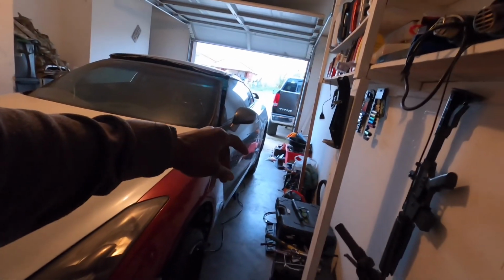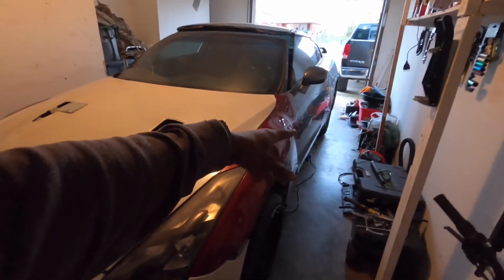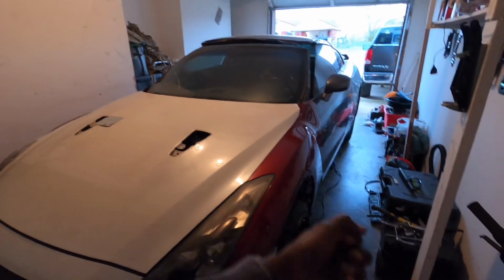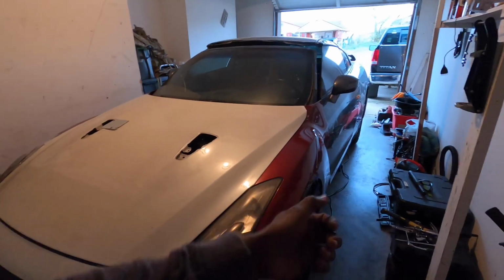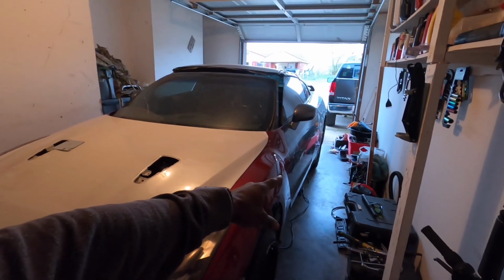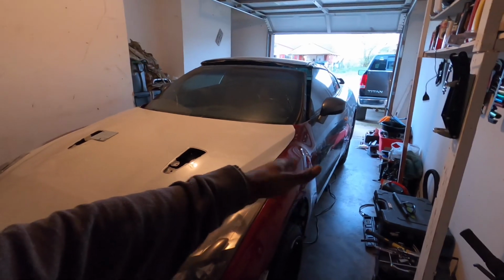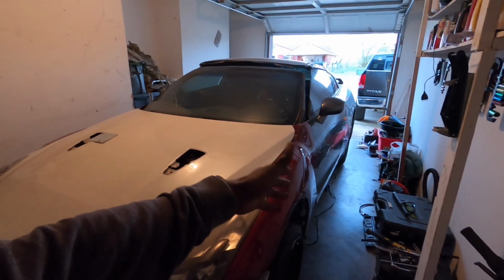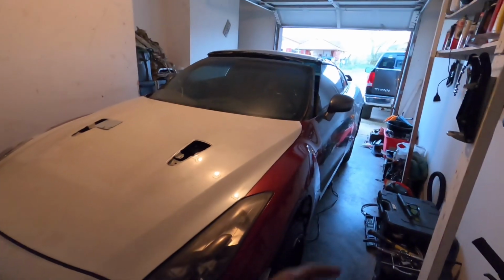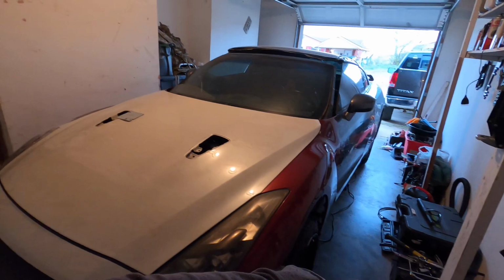And then I have little dents on the quarter panels back there. And I'll pull the dents on the quarter panels, basically, with a stud puller. And after I do that, I'll basically be able to make sure fitment's completely perfect before welding, and then weld the body. So, and I guess the videos to come, hard mounting the doors with custom brackets and the GTR door hinges.